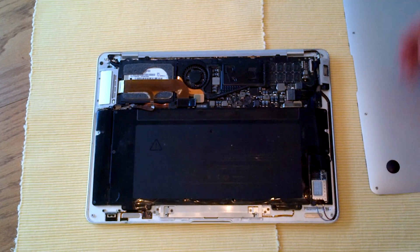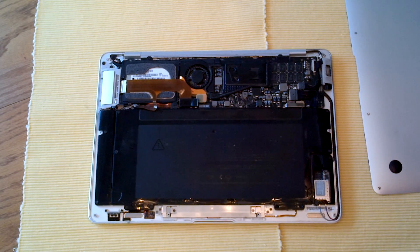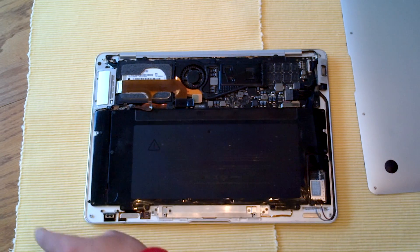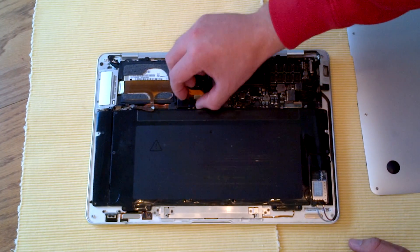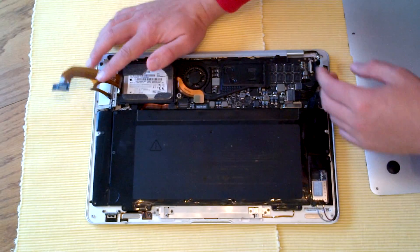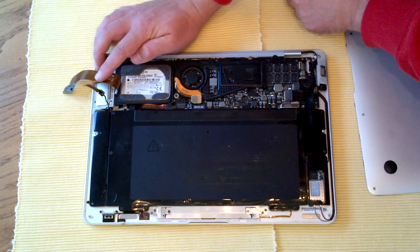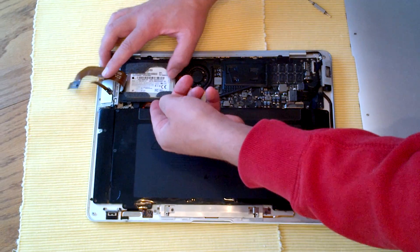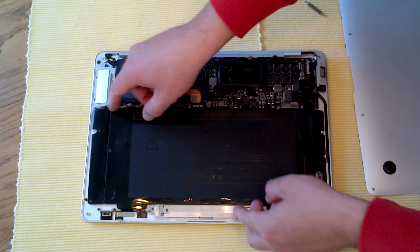To save some time, I've gone ahead and already taken apart the keyboard backing and the battery, and undone the speaker. Go ahead and lift this up right here — it's a simple pull tug — and underneath there are two screws which you'll need to loosen up a bit, not totally remove, just loosen so this is flexible. Before you do that, let's pull up the battery.